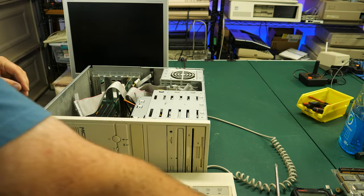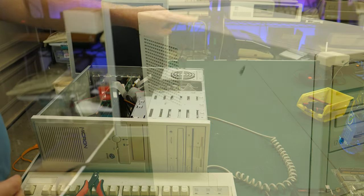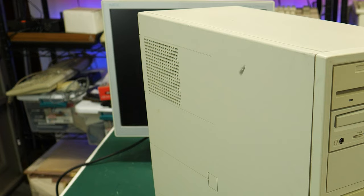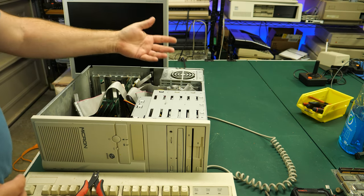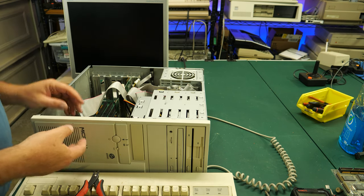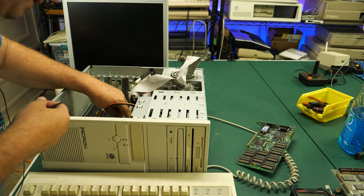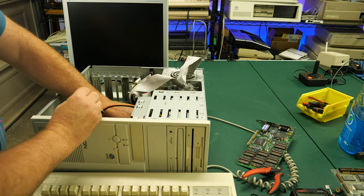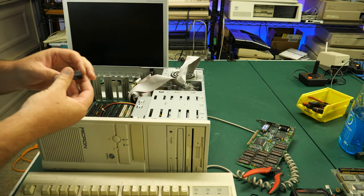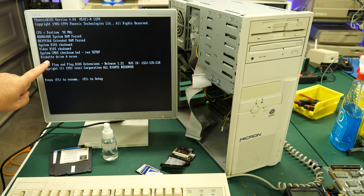While I'm getting this out, I should mention this also has a fan cage here for airflow, and the case has airflow holes where you could mount a fan. I think if I take off this screw, this cage will pop out and you can mount a fan on the inside to increase airflow. There's also a place to mount a fan up front. This chip is indeed a DS12887A, so the DS12C887 replacements I got should be compatible.